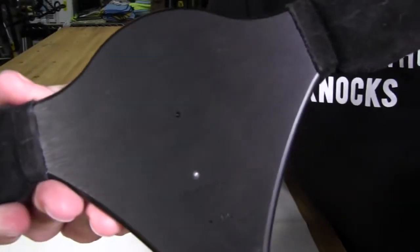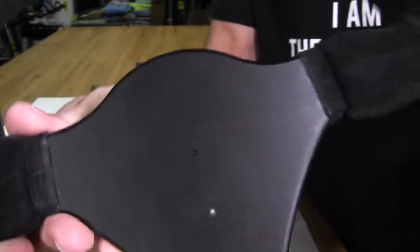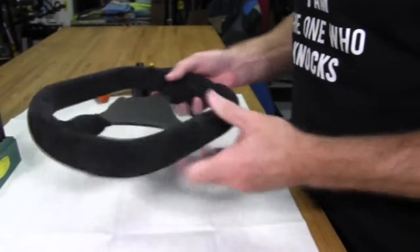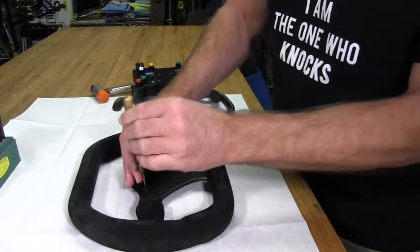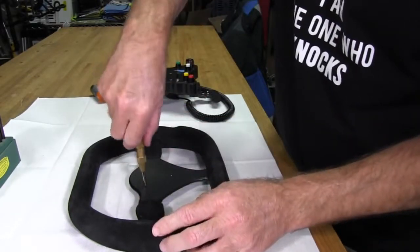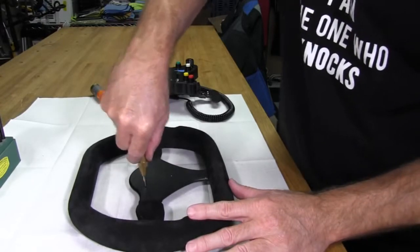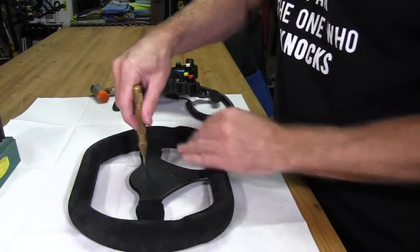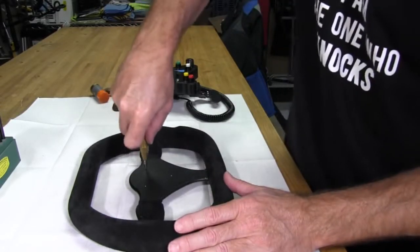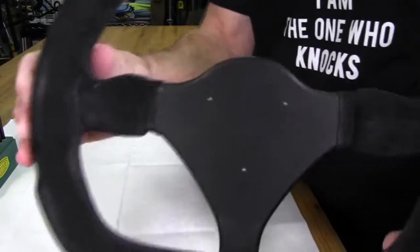See how it opens up the mark — really nice. We can do it to the other two as well. Just make sure you get into the center of that hole; you can feel it when that point is in there. Now we have our three holes marked.